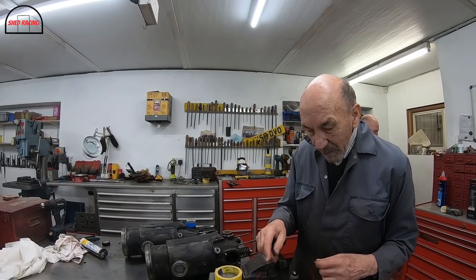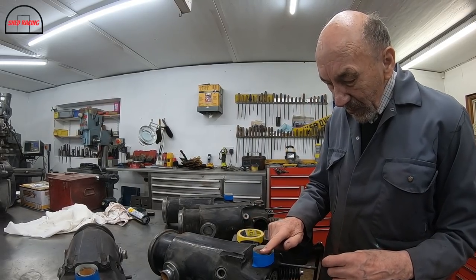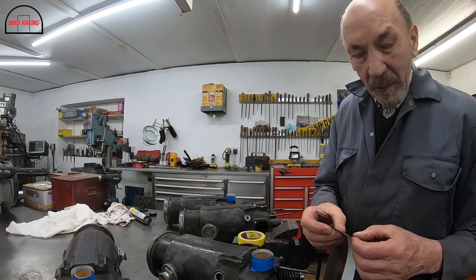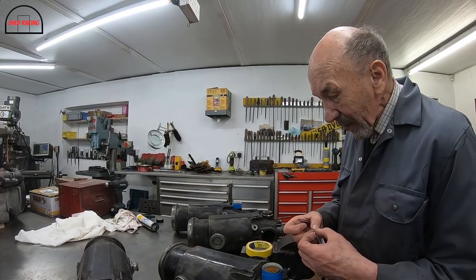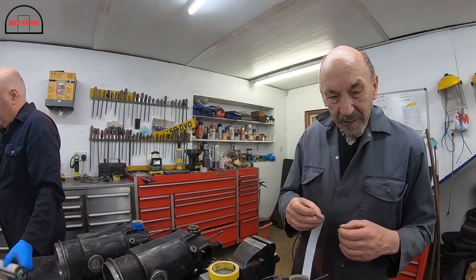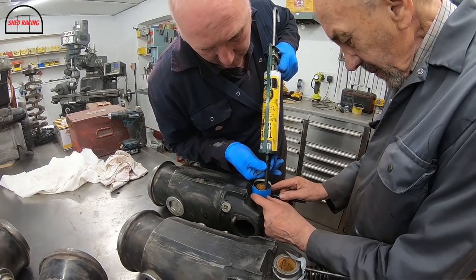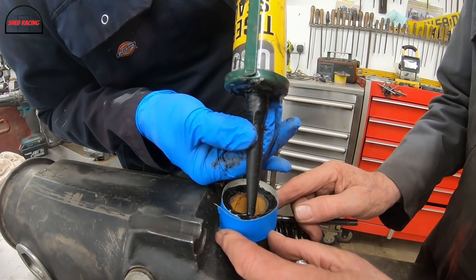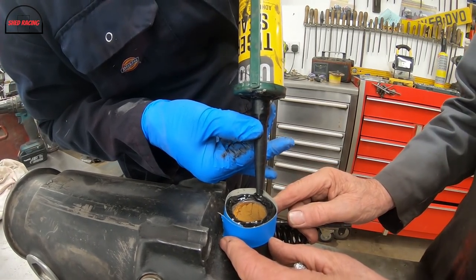And so now we're going to try and redo it, and what we do, we fill it up with Tiger Seal, and then we flush it off, and then when we put it together, we put a little bit of Tiger Seal on, put the barrel on, and then you put the clip on, and they never leaked at all. They were absolutely beautiful. But how I actually did it, I can't remember, but anyway, we're having a go. You leave them till tomorrow, and then you turn it over and do the other side. And as I say, we can't put the barrels on until we've done it. And we're going to put that on the bottom of the barrels as well.